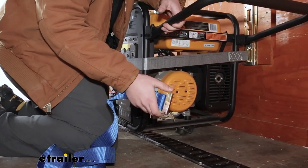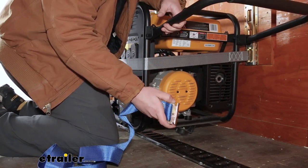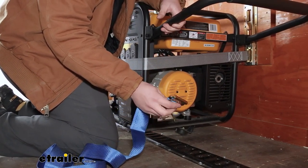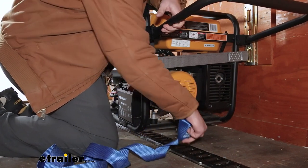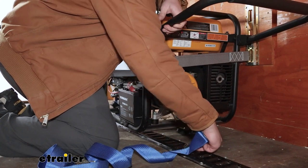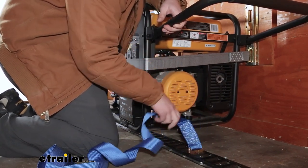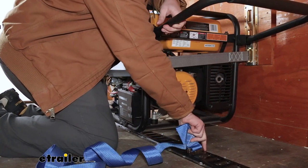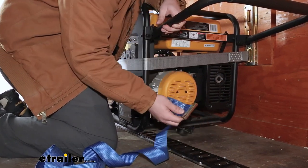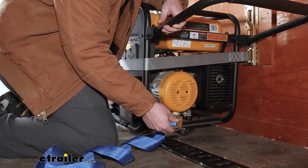These are going to work just like any other E-Track accessory. We've got the trigger up top — that will be the point that locks in and feeds into the E-Track first. So by pulling that, feeding it in, and then pulling it up, you can see it's locked in. Then to release, we just repeat that same process but in reverse. So we can mix and match, move this around the E-Track wherever we need it, and get our tie-down point.